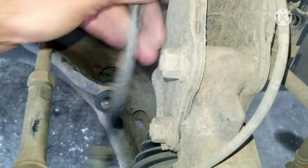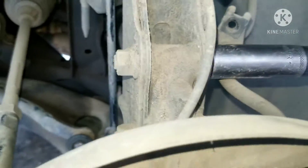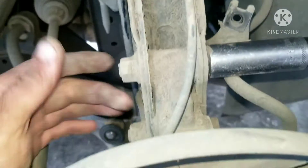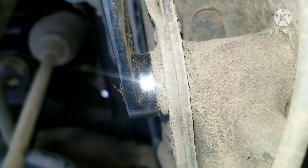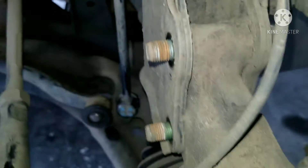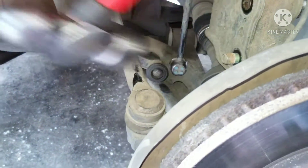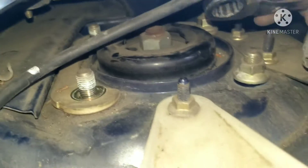But that's in the way. We're going to leave that attached and pop these off — they are 17s, it's probably a 17. I just want to make sure these aren't slotted so that I can not mess with the alignment. We're going to end up with the impact. This is a clip that pulls it out like that, and that comes out of there. Then we have our bolts. They're not slotted — there are four 14mm bolts or nuts.